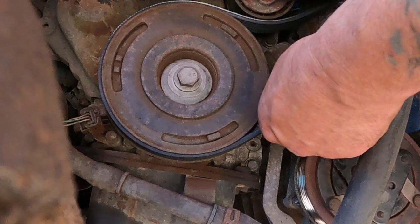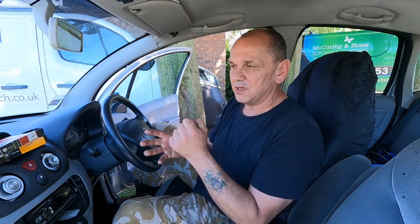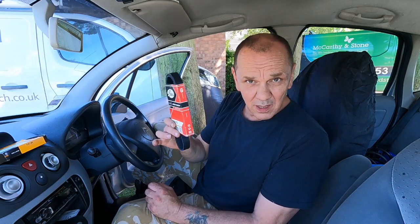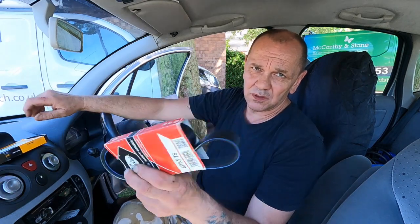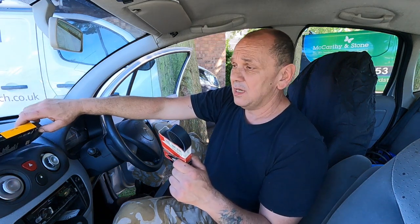While editing this video I just noticed the movement on the pulley - you can see it sliding across - I reckon that's the fault, but we'll put a new one on and see. Some belts you'd have to adjust the tensioner by moving the alternator to get tension on a single-V belt - those belts always snapped. Nowadays these poly-V belts last a long time; it's a good reliable system as long as you've got a good tensioner and the grooves in the pulleys are clean. I always carry a spare belt - even if they're reliable, just keep one just in case. My brother-in-law had something fly up into his crank arrangement and cut the belt in half.